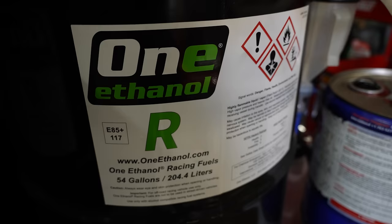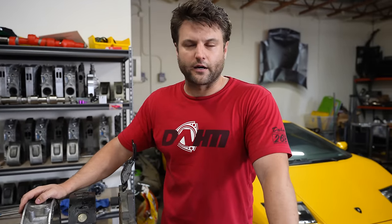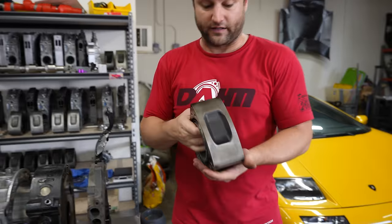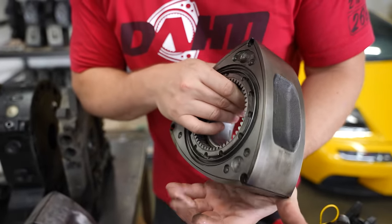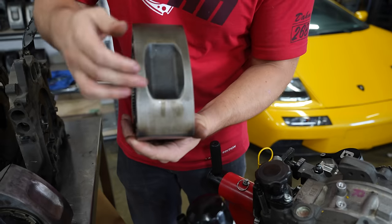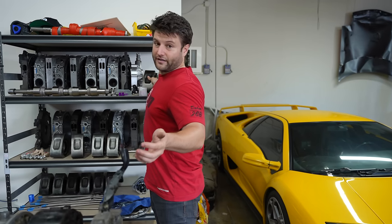So how do you solve this? E85. I saw a lot of old guys on the forum saying it's gunking up engines, but let me show you this. This is a rotor that was running some E85, but then crankcase oil got into it. These are the rotors from the four rotor — perfectly fine, not touched, no cleaning done. You can see the oil's falling out of it still. This is E85 and pre-mix — that's what comes out of the engine. There is no carbon shit to pre-ignite on this. It's a wonderful thing.